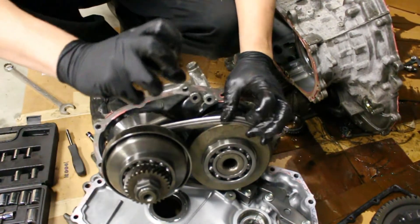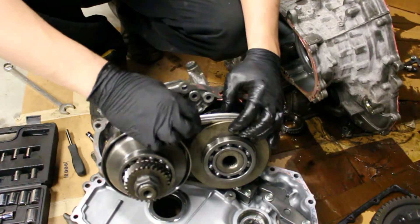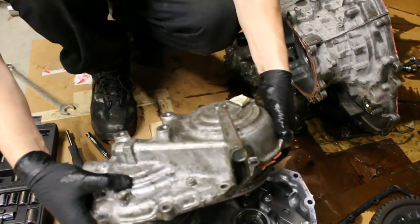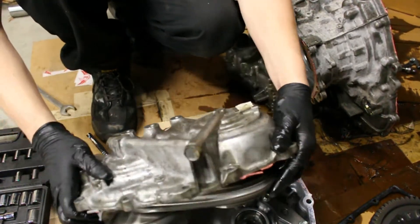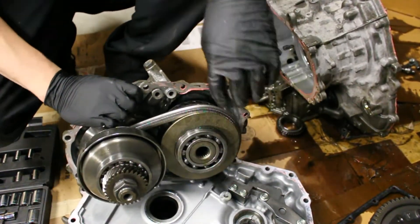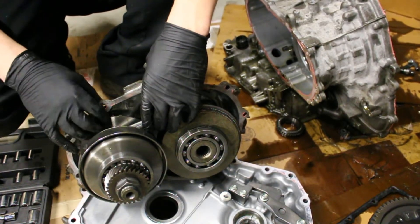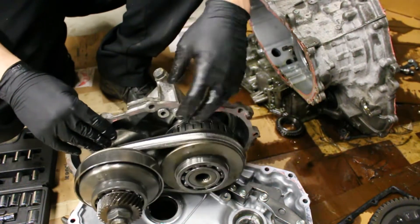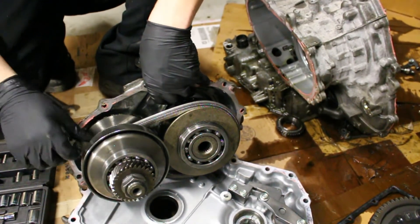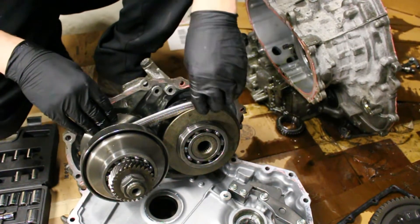This is what makes it so hard to upgrade for performance guys — it's hard to go past a steel and Kevlar belt, and that's about as tough as the material gets unless you go titanium. Slippage occurs from fluid pressure not contracting the pulleys enough. On the back you can see the fluid passageways, and you have your valve body at the bottom which controls fluid flow to each pulley, giving you your gear ratio. You can't really upgrade the pulleys either — making them harder doesn't give you more friction, and adding grooves would just set and ruin them.